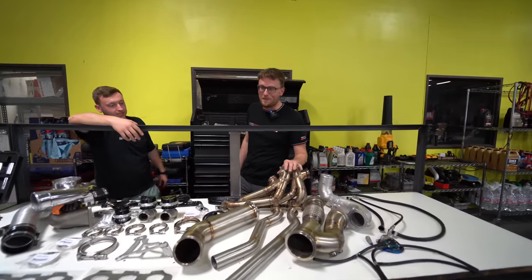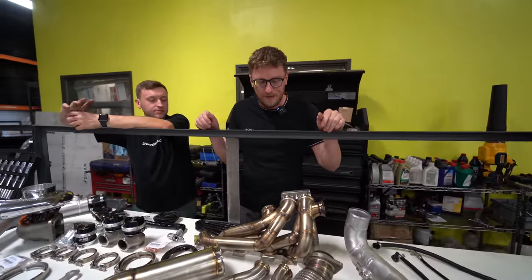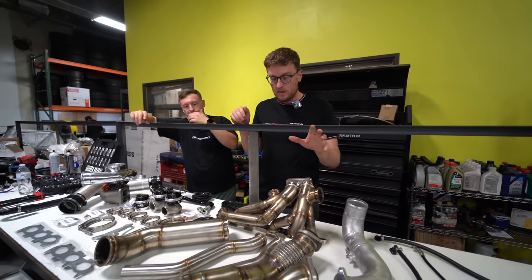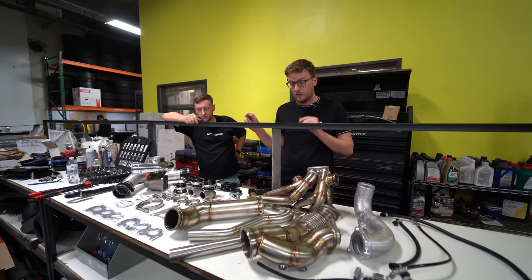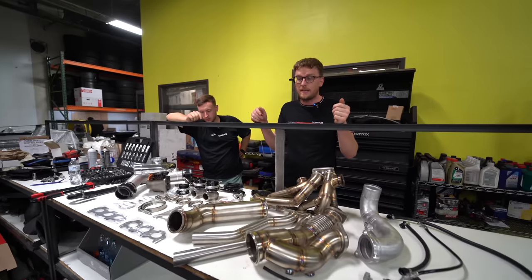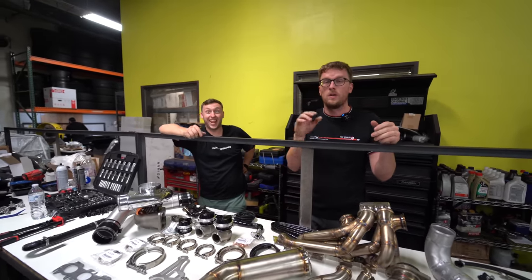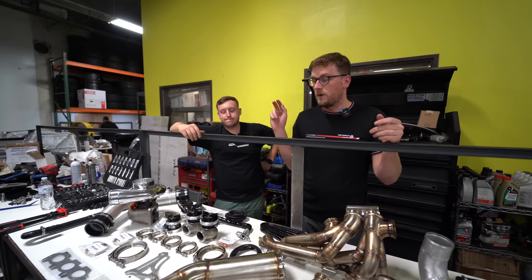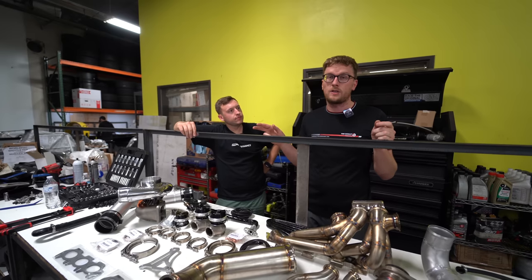Yeah, we've just got the bubble wrap off it after putting it through all the luggage, which was a mission in itself. But yeah, so we've got obviously the manifold. It's a twin wastegate setup. We're going to be running Precision turbos on these builds. Two variants on that. So you've got the 6870, which is good for about 1,000 horsepower, so that'll be for your more stock engine and gearbox guys. And then we offer a 7275, and they're both going to be the next gen turbos.